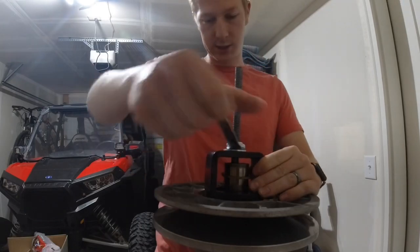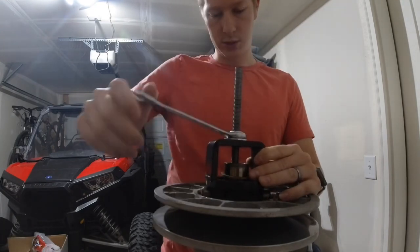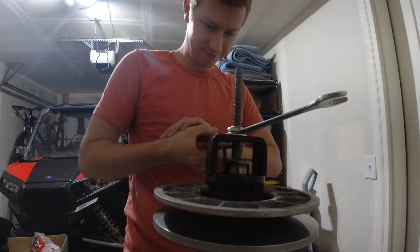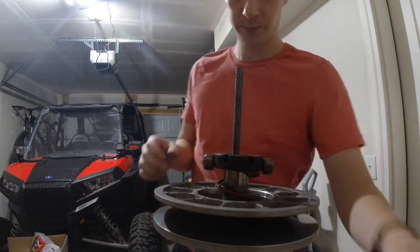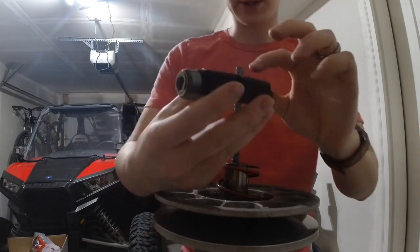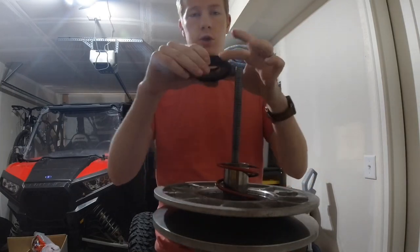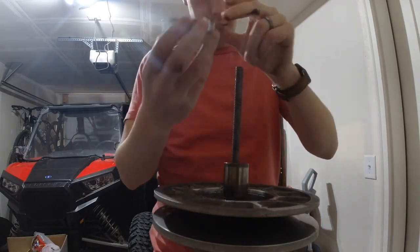Now that we have the snap ring off, we should be able to take this out, put the new spring in, and keep moving forward. That stupid snap ring delayed me a whole weekend — I had to wait for a new one to be delivered. Now I'll take this all the way off. I'm going to slide this piece off — I made a mark because on the splines there's a portion it has to line up with. I put a mark on the shaft and also on this piece. I'm going to take the spring out and here you can see the lower carrier for the spring. I'm also taking off these rollers here.